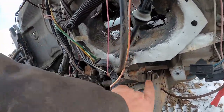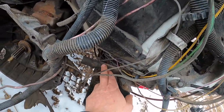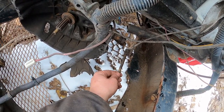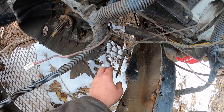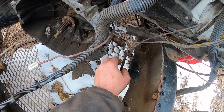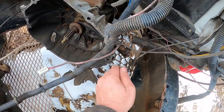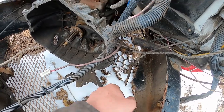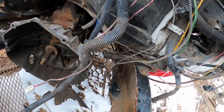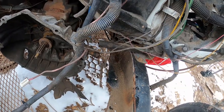Okay, so this right here is some of what we're looking for. You've seen that I already have this piece. This part of it is the adjustable rod. I don't have that. And I don't think that I have this ball that goes on the bell housing. And if I'm right, all that's missing here is a spring to keep this rod against the fork there. So we'll grab this and we'll probably go look at the other truck where we actually found some. I think it has a spring. I'll look at it and see what else I need.